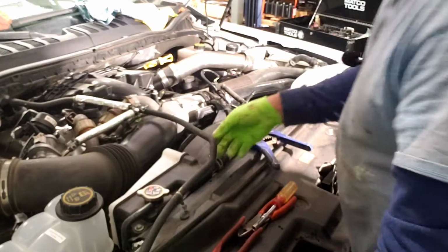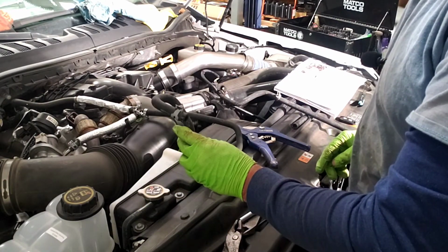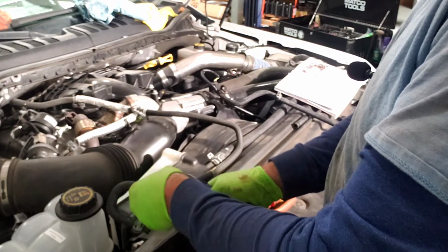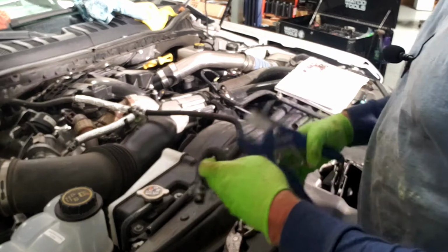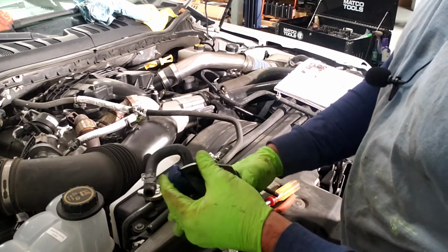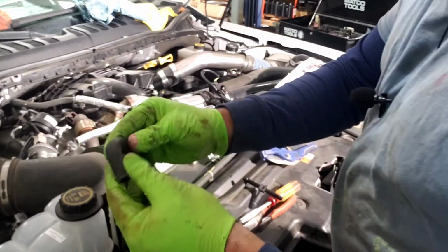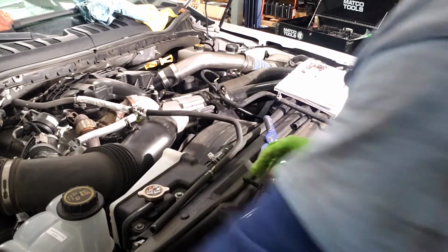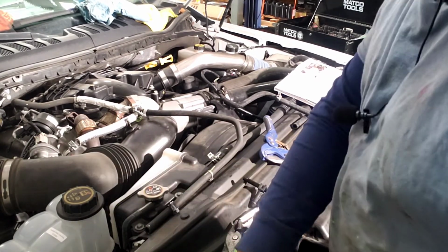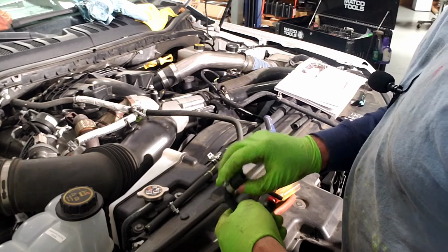Connect the hose, and I go back and tighten all these later, and then this will hook up directly to the radiator itself. Before you connect this into the radiator, we're going to modify it. We'll take our cutters and we're going to cut it right before it goes into the bend, and then we're going to cut a section. You're just cutting this one corner out of this hose. Okay, there's the hose back, and you got this end. Take your hose clamp, put it on here.